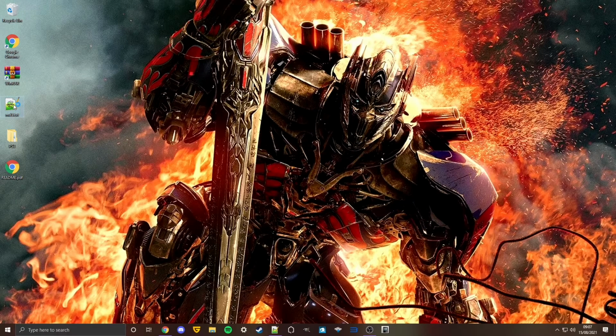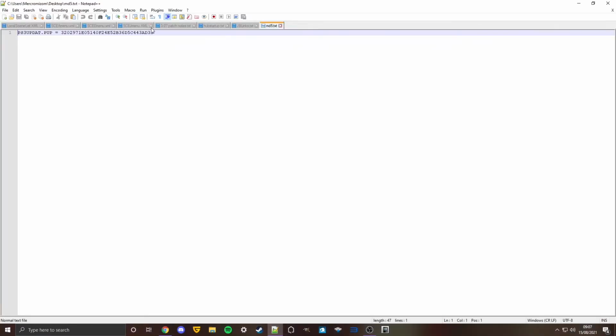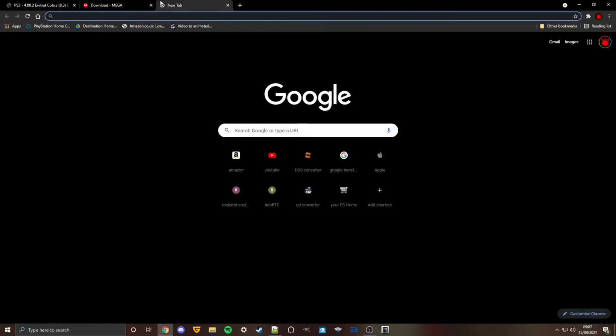And then inside here there's going to be an MD5 hash. This is to check that our download isn't corrupted, which can be pretty important because if you've got a corrupted download, the firmware won't work properly. So we're going to copy that. Going to copy the link to the MD5 hash checker, which will also be in the description. All of this will be in the description, obviously.